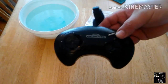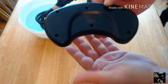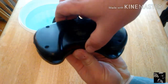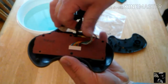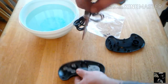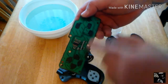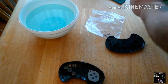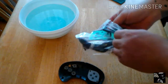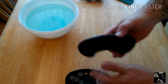Just to be thorough, let's start taking the controller apart. There are six screws in the back — remove them and carefully pull the controller apart. You'll find the guts inside; pull it out gently because it's seated on posts. Have a look at the board — it looks good. You can take a pencil eraser to some of the contacts to clean them up. Take all your electronics, put them in a little baggie somewhere safe, and set your screws aside too.